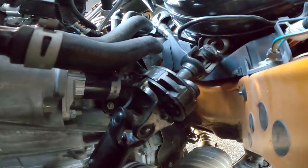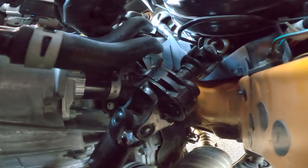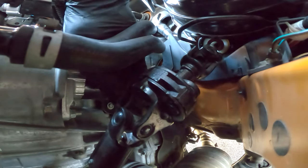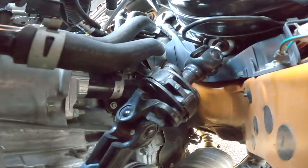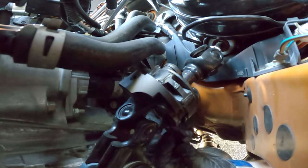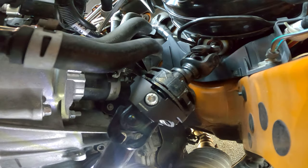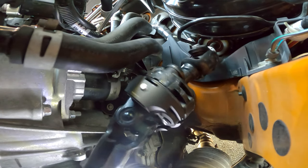Turn the steering wheel so you can position these in a way that you can easily access them. The bolt on the steering wheel side is going to be near the brake master cylinder, and the bolt on the other side is more easily accessed through the wheel well. After doing the top bolt, rotating the wheel 180 degrees aims the second bolt in a direction that's easy to get to. Once both bolts are loosened, rotate your steering wheel so the steering dampener faces in the correct orientation — clamps facing sideways, not up and down, or you'll drop the clamp pieces. Before attaching the part, spray it with some lubricant, as it can bind up without enough lubrication.